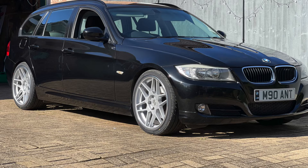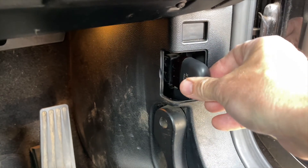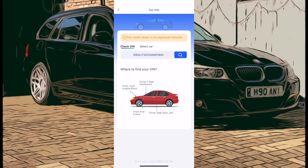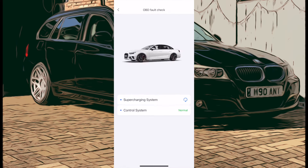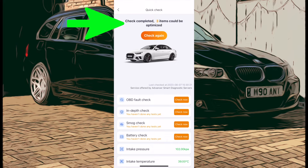Let's get it into the 2010 318d diesel BMW. Put the little dongle into the EOBD port — just by the driver's accelerator pedal on the kick panel. Pop the ignition on, give the button press, and we're in. Now we just have to pair the dongle to the BMW — you take it away from the Peugeot and redo it to the BMW. Connection success. Because this is a 2010 model year, it's actually found the VIN code automatically. It does its self-check, runs the quick test — no faults found on the car, which is strange because I know it's got some.